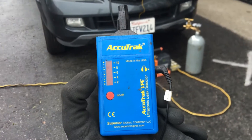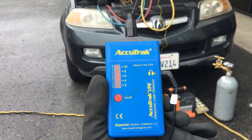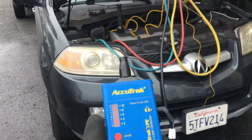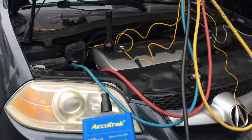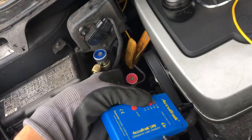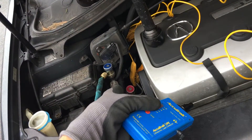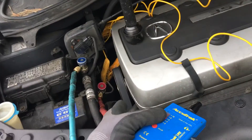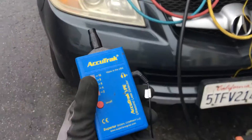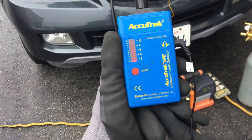We're going to use the ultrasonic leak detector on this one since it had only 9 PSI of refrigerant in this vehicle — it's a 2005. Some of the clues I saw were oil buildup on the high side line and a little on the low side line cap, so the cores are going to get changed. It's an old car, just change the cores — they're cheap and fast — but that's not what I'm going after right now.